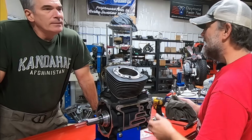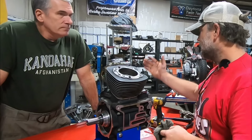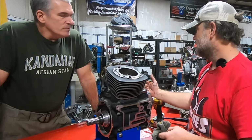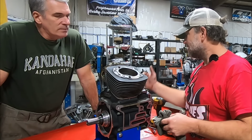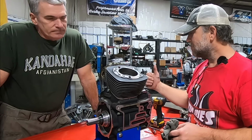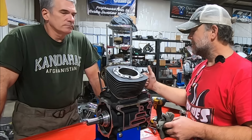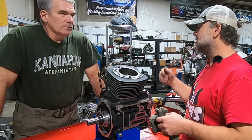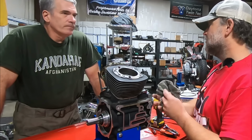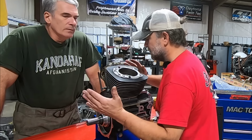That's exactly what happened. It had to be. We're going to find out in a minute when we measure crank runout when we open up the cam chest. But what honestly I believe this was, we saw it right off the bat. We had the smell, the burn smell, drastic overheating. That affected ring seal. That put the carbon on the piston. It starts detonating. Nobody can figure out why. And he puts octane booster in it to stop the detonation. There's no question it was running octane booster.